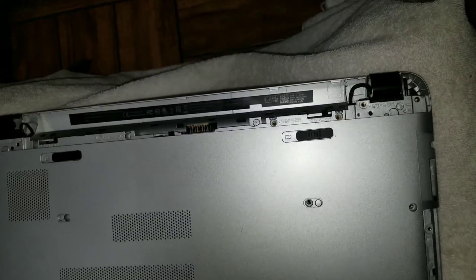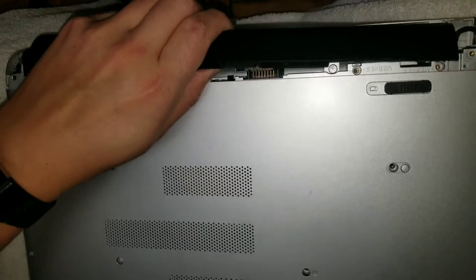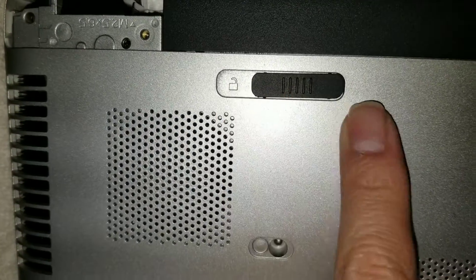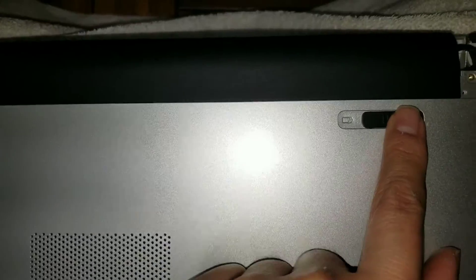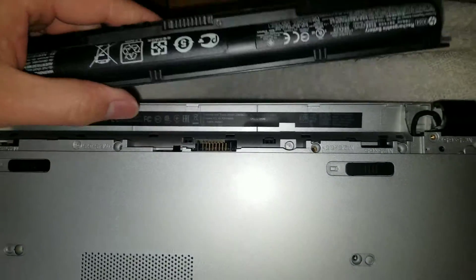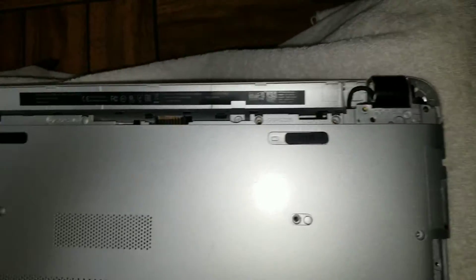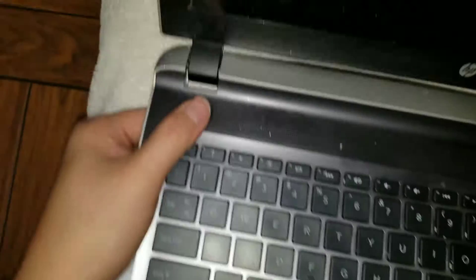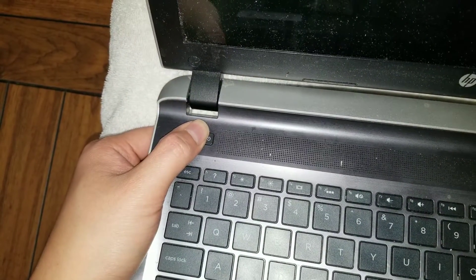I forgot to show — for the battery, make sure it's in the unlock position. Unlock it and then slide the latch over, and the battery will just pop up. Roll it out like that. After that, just slowly open the lid — don't open it too quickly because you can damage the hinge area. Hold the power button for a few seconds just to drain any residual power, just to be safe.